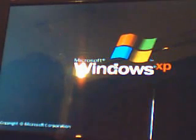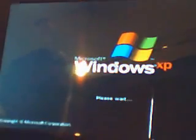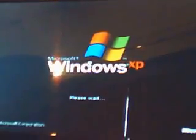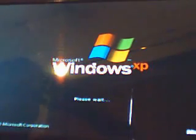What you could probably do is switch it around so you have the USB drive booting first and then have the hard drive after that. So then it's just so you have the drive letters at the beginning, but once all the files are copied you could probably boot from the USB to stop that HAL DLL error coming up. But if you just want to keep it as it is and do exactly what I've done, then you'll notice that error. Just simply boot from that USB drive.